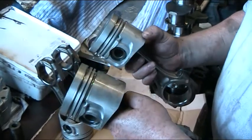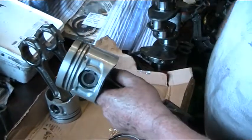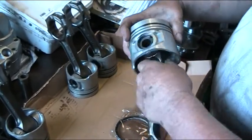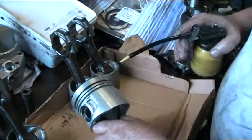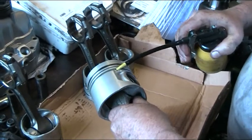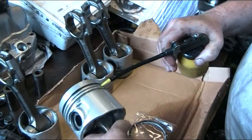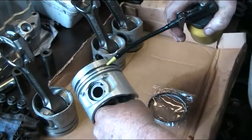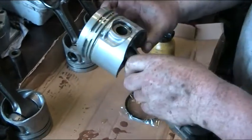In this clip we're going to fit a set of piston rings onto a piston. I normally do this without the aid of any tools — experience has taught me how to put these on without the tools you see on the market nowadays. We don't really endorse them; it's got to be a very heavy ring, like from an HGV, before we use those. The first step is to cover all of the galleries with oil, since this is the first start-up of the engine. It's a messy process but it's clean build oil. Get all the way around the grooves.